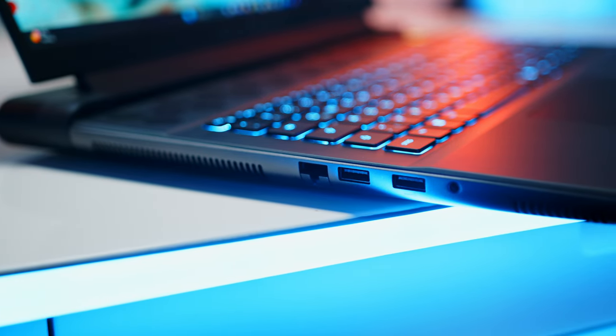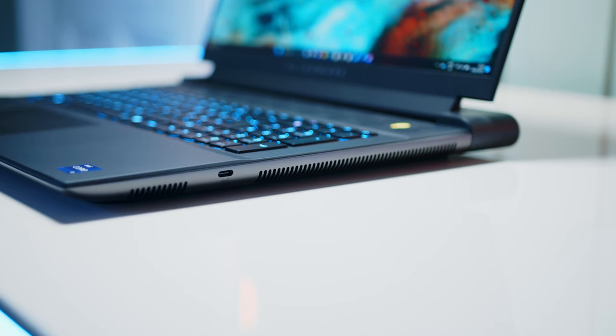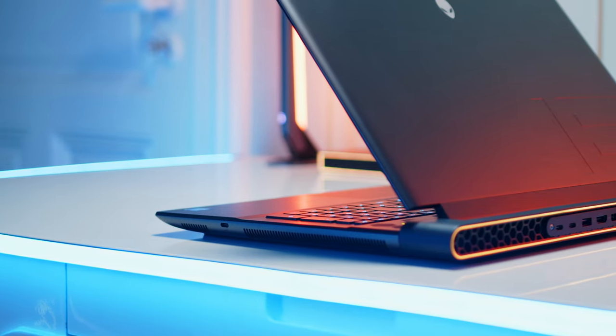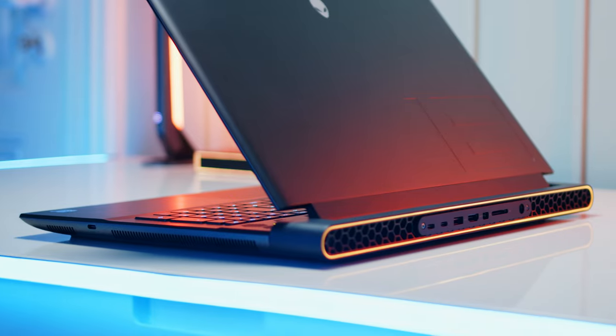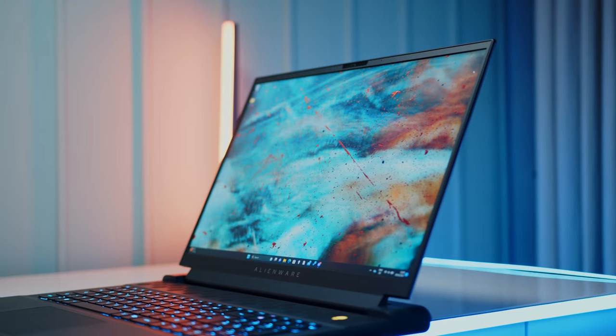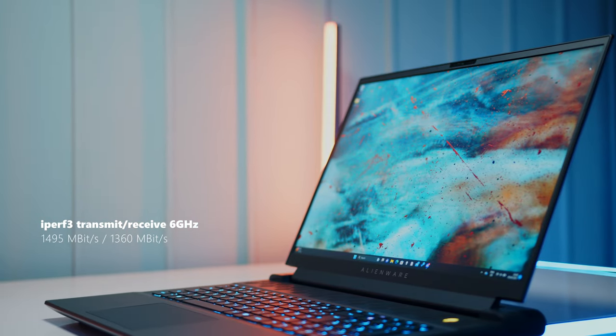On the left you can find two USB-A ports of the 3.2 Gen 1 standard, 2.5 Gigabit Ethernet and the audio combo jack. On the right there's just a single USB-C 3.2 Gen 1, and the remaining ports find their home between the large cooling vents in the back. Here Alienware made room for two USB-C Thunderbolt 4s, a third USB-A 3.2 Gen 1, HDMI 2.1, a mini DisplayPort, a full-size SD card reader and the power connector. While it would have been nice to have the faster 3.2 Gen 2 standard for all USB ports, the sheer amount of connectivity should not leave you wanting. The SD card reader offers very fast transfer rates, which is great for offloading camera footage. Wireless transfers reveal only average numbers compared to the competition, but speeds were stable throughout testing.